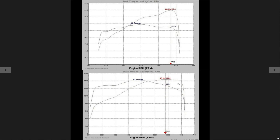When we retuned it, the only changes we made were to the cylinder head. We put a competition three-angle valve job on it, then blended the bowls, gasket matched the intake, gasket matched the exhaust, and surfaced it, just a real minor skim. We didn't try to up the compression or anything. Then we refaced the valves and fitted a Rocket Motorsports HD spring kit, as well as a set of the Stage 4 camshafts.